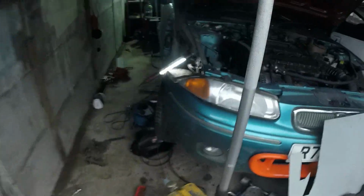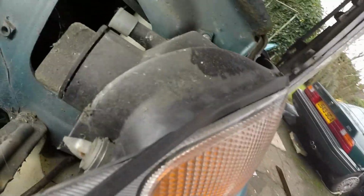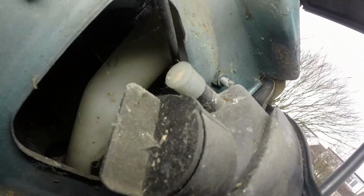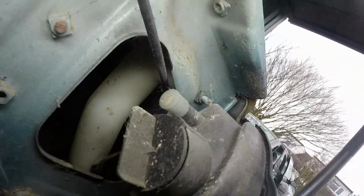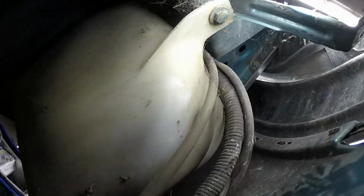I've made yet another interesting discovery about this car's history. If you look carefully, now the wing's off, you can see some grinding marks there. It looks like it's had a new front lamp panel at some point, because you can see the heat burn from the welding there. And also if you look right in the front there, so yeah, it's definitely had some action, this thing. And yet when I did an HPI, is it HPI? Vic check HPI, yeah, it's never been recorded damaged.